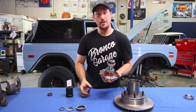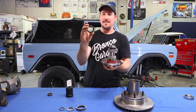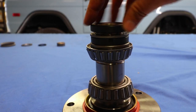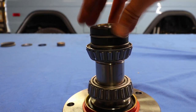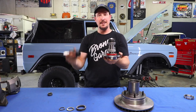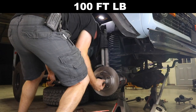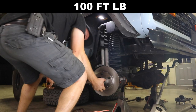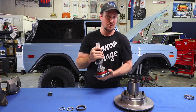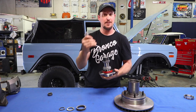The last step before putting your hub lockers back on is the second outer nut — this one has no nub, it's completely smooth on the back and front. Slide that third piece on and torque it down to 100 foot-pounds using your spindle nut socket. If you can't do that, make sure you find someone who can. I highly recommend not using an impact gun — it's absolutely critical that you get the torque just right.